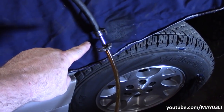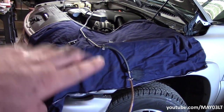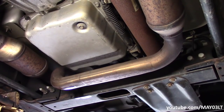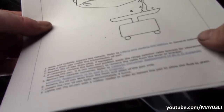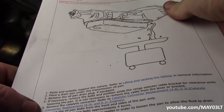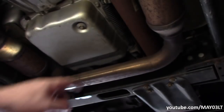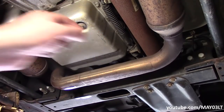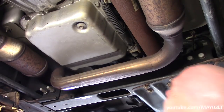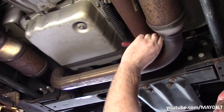I made a little fine-tuning to the adapter that leaked. We're going to leave the apparatus hooked up — now we're going to drop the transmission pan and change the filter. Here's our transmission pan. I went through the service information and it wants you to remove the catalytic converter, and we're not going to do that. But I think what we do have to do is get that shift bracket out of the way. The problem is I can't even see the bolts that hold that thing down, so the best I can do is just explain what I'm doing.